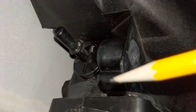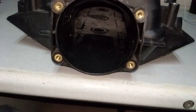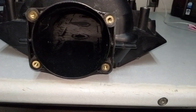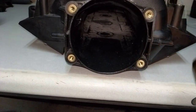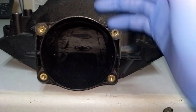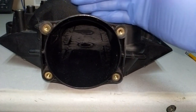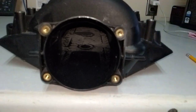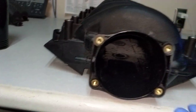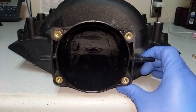The epoxy is there to strengthen these edges, and also some on the bottom, because it's really thin and it's easy to go completely through the plastic. You can shine a light on the bottom and see where it starts getting transparent. On an NA application it shouldn't be too much of a problem as long as you don't have any leaks or pinholes, but for a boosted application anything past 10-15 pounds I would be very cautious.